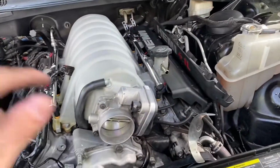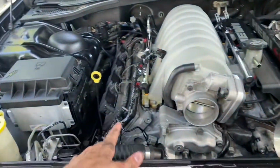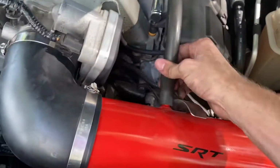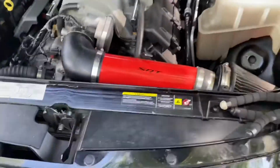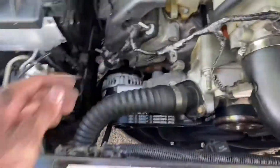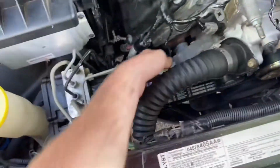Next thing you're gonna do, put in the intake, button up your coil pack cover, and then plug everything back in and then start it up. It's all buttoned up, actually. I lied. Now the intake's all buttoned up. Intake's all buttoned up, boys. She's in there. Just goes to show that you can, in fact, install this without removing the radiator hose. I double checked everything was tight, double checked all my sensors, and let's hook the battery back up and start her up.